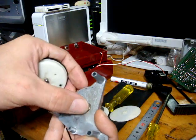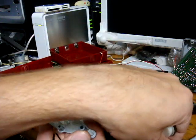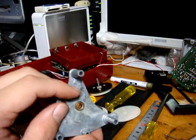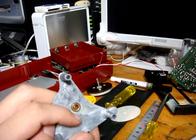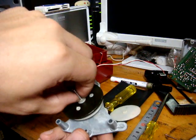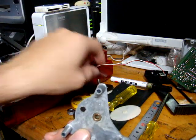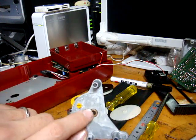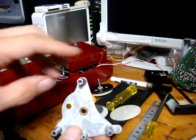You can add a little oil inside to help loosen it. Then remove your spindle — you should find a plastic washer there too, so try to keep those aside. On the bottom you might notice some oxidizing or crust. If it's preventing the spindle from spinning freely when you put it back, use sandpaper or a file to smooth that area out. Try not to touch the center post — that'll just cause another headache.